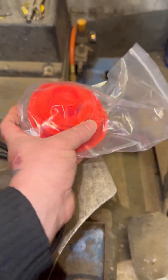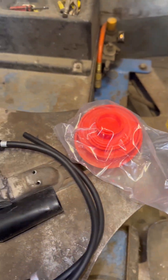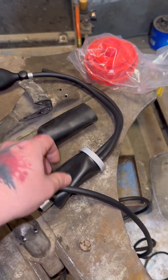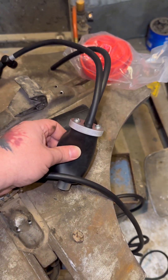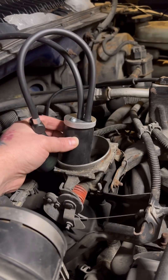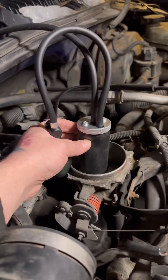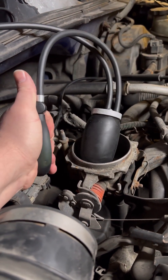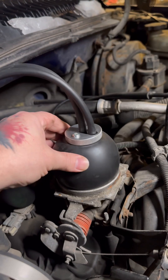Here's a large assortment of cap-offs, which is really good. This can go in your exhaust to find exhaust leaks. Here's an extra bladder, and this is what attaches to your throttle body. Almost any engine you're looking for vacuum leaks on is going to have a throttle body, so you just use this bladder and squeeze it. We're on there nice and good and sealed.